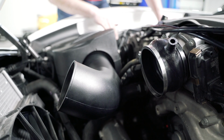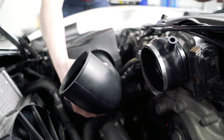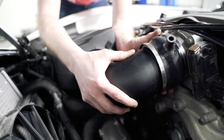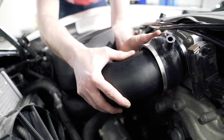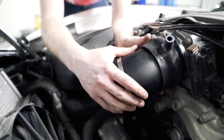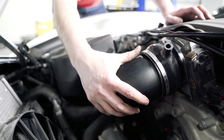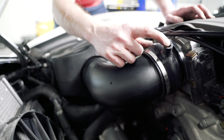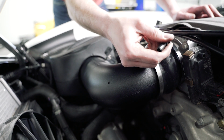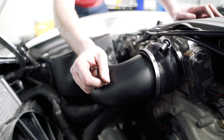We're just going to loosely install those. Now that we've got those 2 screws loosely installed, let's get this intake tube stuck into the coupler on the throttle body here. About like so. Now that we've got that slid in there, we're going to stick the quick connect fitting supplied into this boss on the coupler. Just presses in there like so.